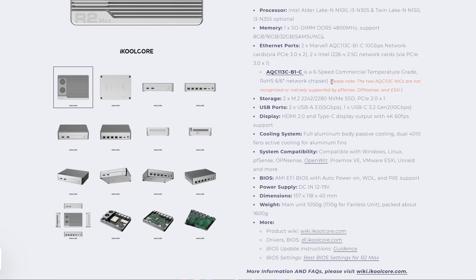This system is marketed as a firewall, and naturally you'd run something like pfSense or OPNsense on a unit like this. But there's a big gotcha: that Marvell chipset running those two 10-gig connections isn't supported in FreeBSD, which is what pfSense and OPNsense are based on. Basically, you can't use it as a pfSense or OPNsense firewall, so calling this a firewall is a bit of a stretch. That said, the chipset is supported in Linux, and it runs Ubuntu and likely Windows just fine.